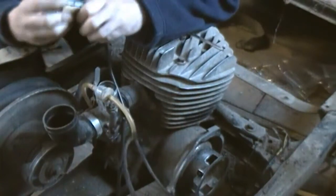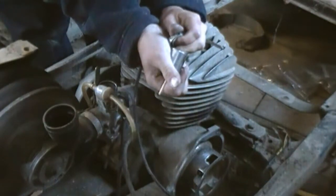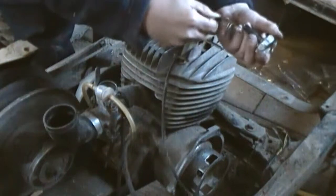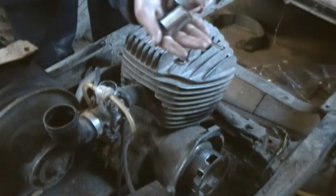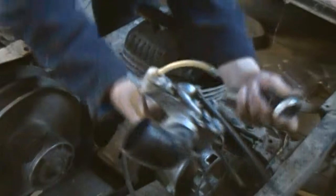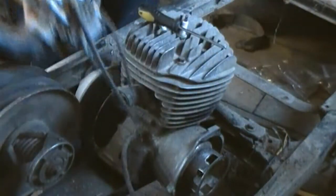1983 is a whole different story than nowadays. So decompress that spring, and then the cable comes out. You can pop that out, and you've got all the pieces for the carburetor. And we'll give that all a good clean. So, just give it a twist, pop it off, and there's the carburetor. Oh, we're leaking a bit here, but yeah, that's going to be into the box over here for rebuild.